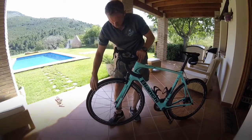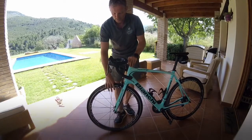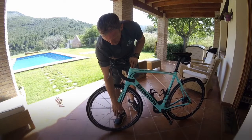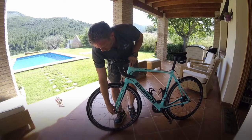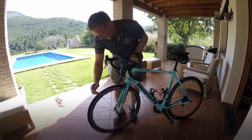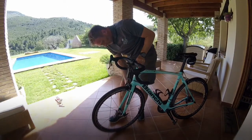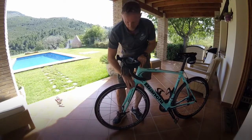So we're happy the tyre's in good condition, the wheel is in condition, it isn't buckled, and it is fastened to the bike with your quick release suitably tight. So now we walk up the frame, checking the frame for scratches or cracks. Mainly cracks in the frame or anything like that which may be detrimental to the structure of the bike. Nothing there. And we're up to the front brake.